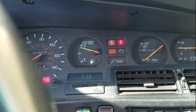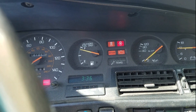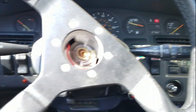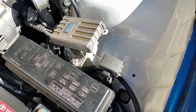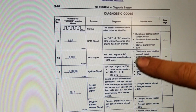Okay, so once you have your codes, write those down and then I will show you a link in the description below where you can look up all of what these codes mean. Don't forget to remove your key and of course take that little jumper wire out of your diagnostic box because we're done with it. Put your cap back on and look up your codes — here is a complete list of all the diagnostic codes.